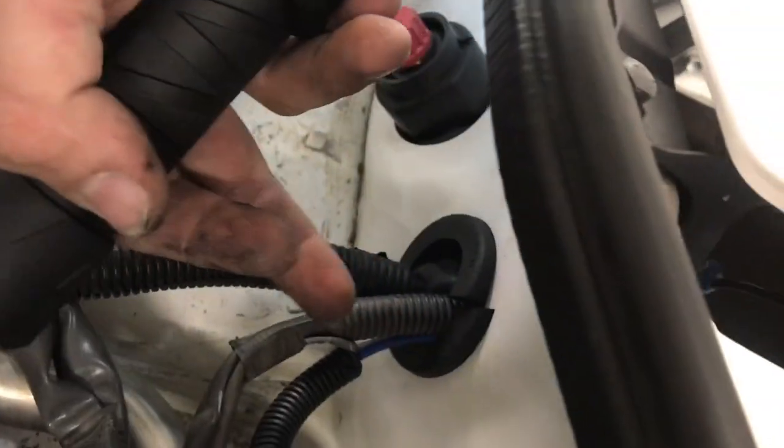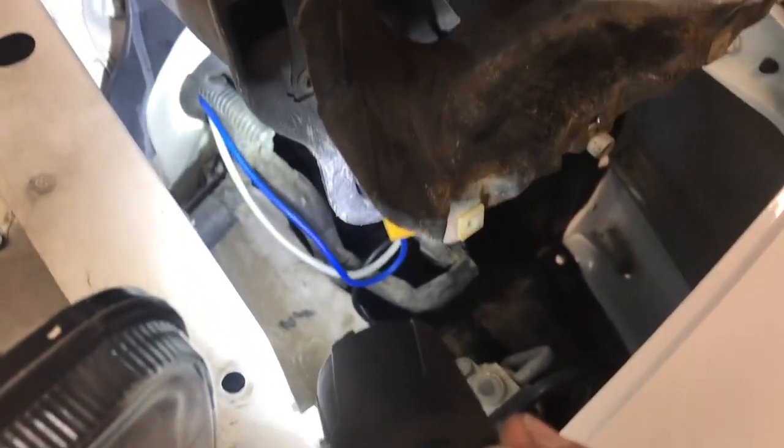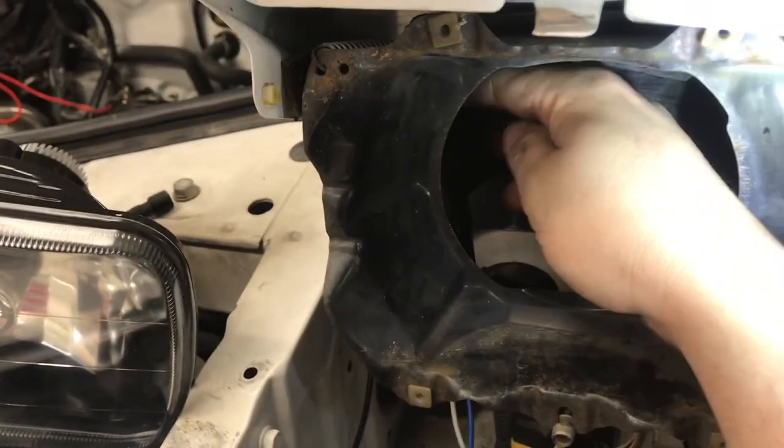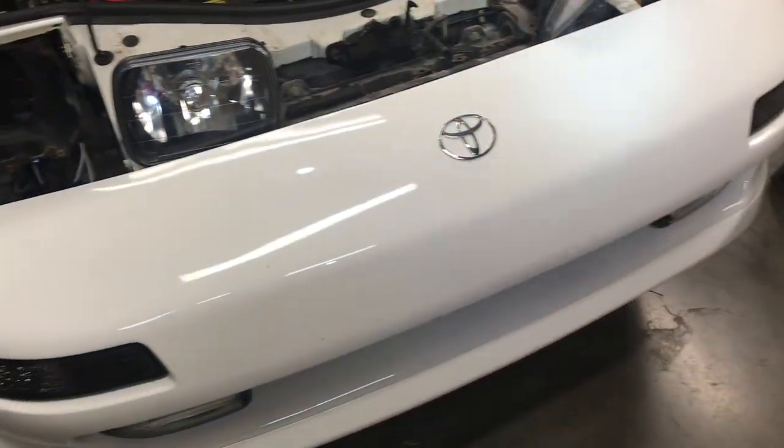For the other side, I put a little hole at the bottom and zip tied it in. This is now the plug to the headlight instead of the old three-prong plug. Then from the relay comes another wire going to the other headlight. I took the original headlight plug, put a slit in it, and ran this plug back into the car so it doesn't get rained on. That little blue and white wire comes through there up to the headlight plug. I also mounted the ballast right in here. The only mod needed was two little tap holes, and those get covered by the trim piece.